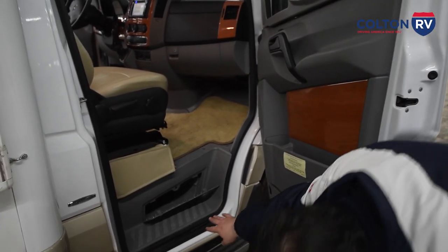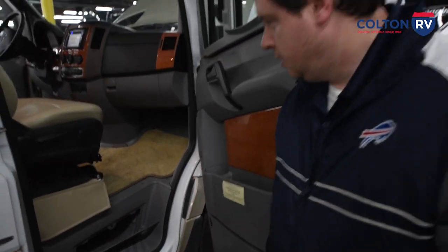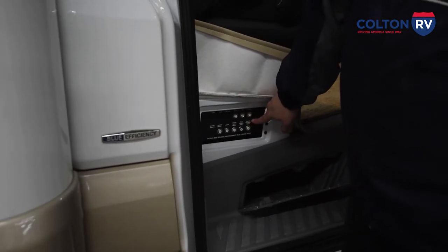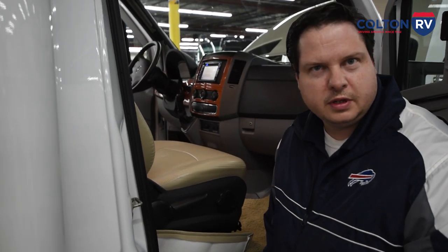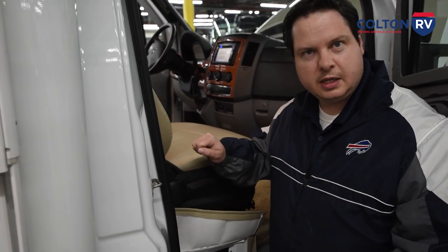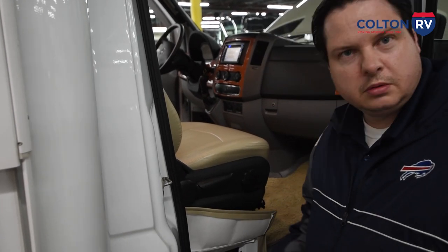Down here there's a handy storage space underneath the driver's seat. Just like on the driver's door, you can actually open this one up as well. Just so you know, there are a few more 12-volt fuses in here, and these are nicely labeled. These will reset some of the 12-volt power systems in this RV — the stuff that runs off the batteries. If you're ever having an issue, sometimes you've got to come over here and check the fuses. These are a little different than your blade fuse — think of it like a pen. When it's working and it's on, it's pushed in. If they ever pop out, they're resettable — you can push them back in.